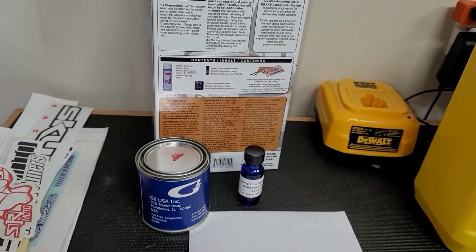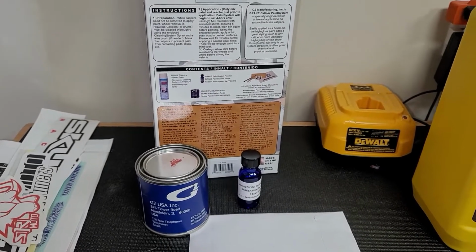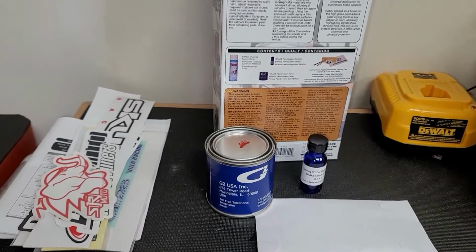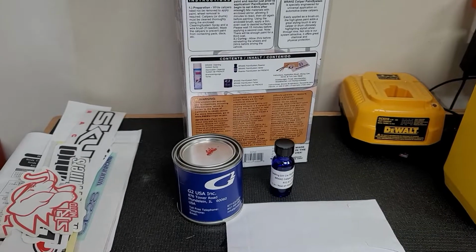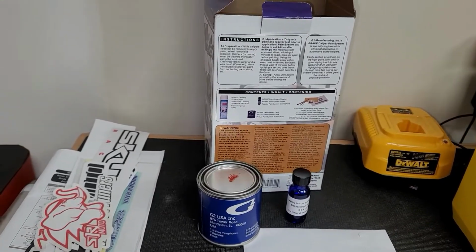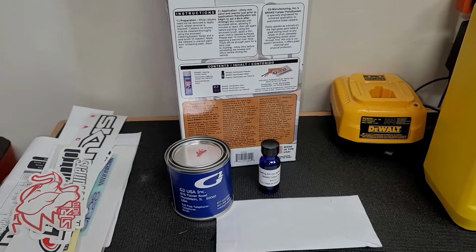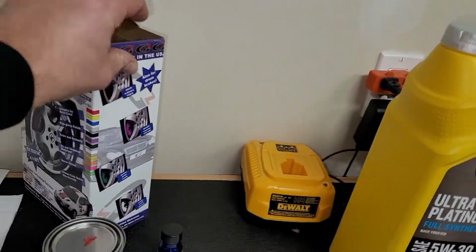And it says it's about 2 hours of curing time before you can reinstall the wheels, and they suggest 24 hours before driving the vehicle back on the road. So guys have to be a little patient once applying this. Make sure the product gets its full curing time. That way you don't have any debris or anything getting stuck to the paint, or it changing color on you. Who knows? But I'm gonna go ahead and give it a try.